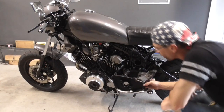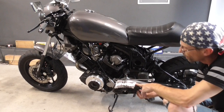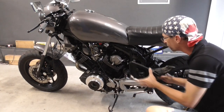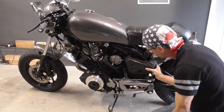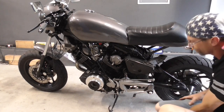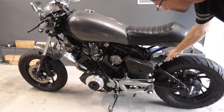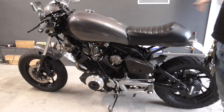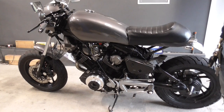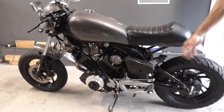Here's our stock air box. Because I got my key and stuff down here, I had to take that corner off a little bit, but I got it all sealed back up just like it was before. So now we can put all this together. What that's going to do is simulate the original air box, because this is the breather and it's very restrictive. So now when we fire it up, if it'll throttle up and come up, we'll know the majority of the rejetting is needed for the more open air box. Let's fire it up.